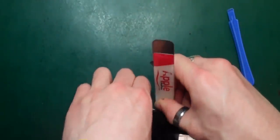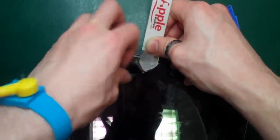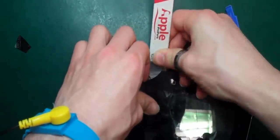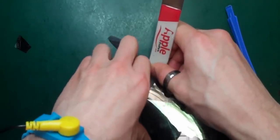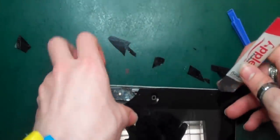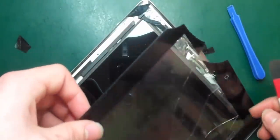Right here — on the right hand side of the home button — you've got the Wi-Fi cable. Go extremely gently, using the iSesamo to go between the glass and the Wi-Fi cable, pushing the Wi-Fi cable away from the glass so it stays with the iPad. If you pull the glass too far and the cable is stuck to it, you'll tear the cable straight off the iPad. Although we sell the cables on our website and you can easily replace it, it's probably best if you don't need to.